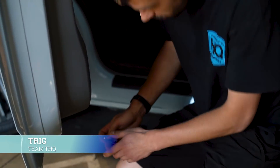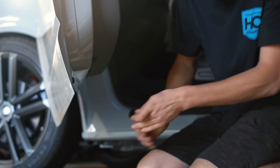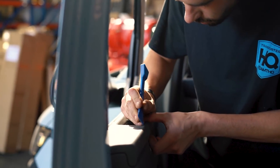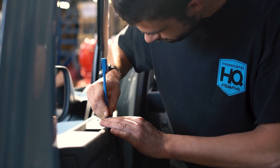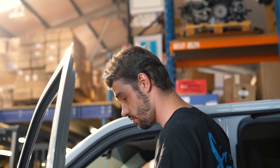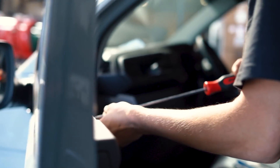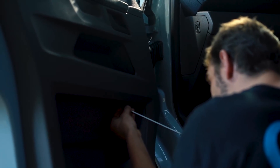To begin, you want a 10mm spanner to get under the door and undo the little clips — pop them 90 degrees so the bottom of the door card can pop off. Then come up to the top and slide a plastic trim tool in here to gradually pop off the cover for the door handle. Behind the door handle cover there are two T30 screws — unscrew those. Sometimes they stay in the door card, sometimes they don't.